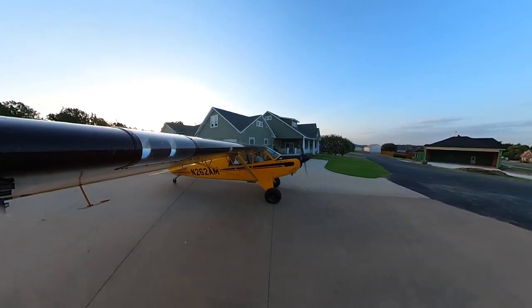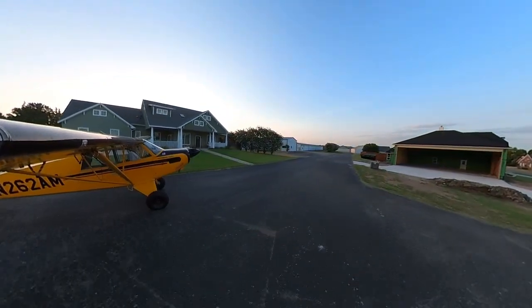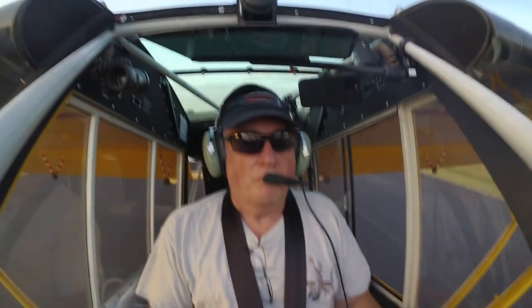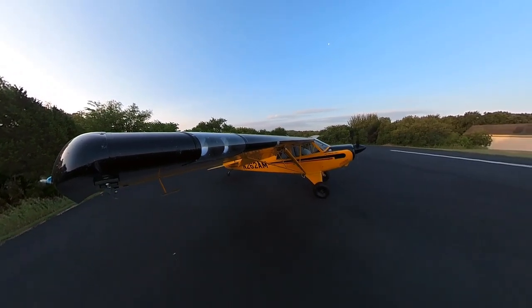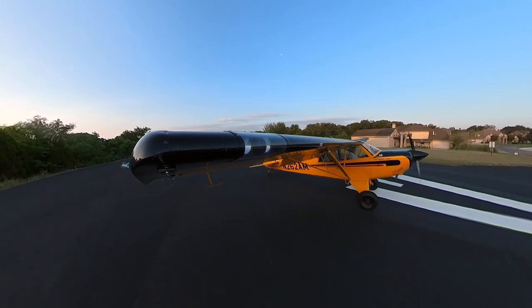I'm not testing for data for an STC — I'm testing for real-world performance relevant to how I fly the airplane, so I don't have to be super accurate. I used a neutral-stick flap-30 takeoff run; the POH recommends that for the shortest takeoff roll, basically flat and let it fly. I simply count the seconds from brake release to mains off the ground. Later I'll work on actual distances, but I need people to help with that.